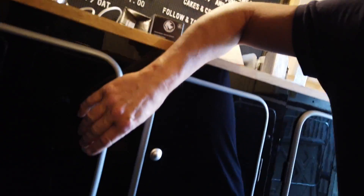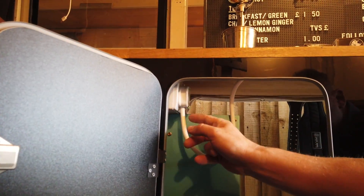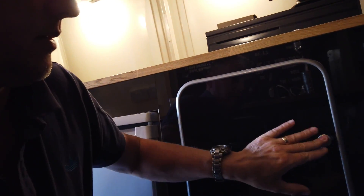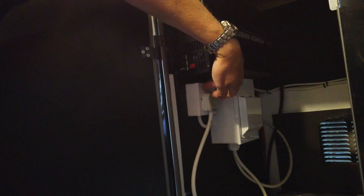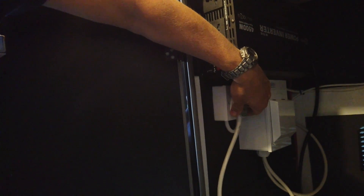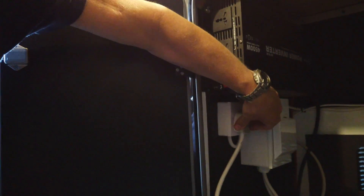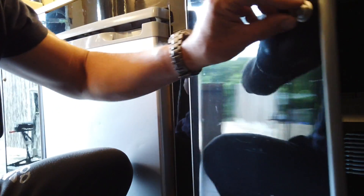The wire comes in from behind the cupboard — it's a bit dark down there but it comes in the side. Power comes into this socket here, and also on the other side of the van we've got the inverter and a power socket which is off the hook-up. When we're not on hook-up, we just unplug it from there, plug it into the inverter, and that's now running off battery power. When we don't want to be on batteries and we're on hook-up, we just whip it out, plug it into there, and we're on hook-up. Pretty easy, nice simple setup.